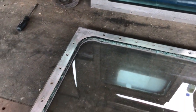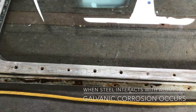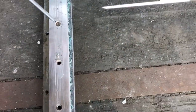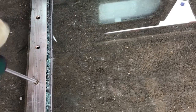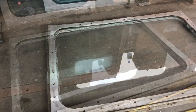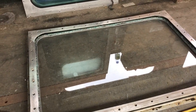Just to expedite the video, I've already taken bits of it apart. When you take a Pullman standard window out like you've seen in a previous video, if you want to replace the glass you have to take all these screws out all the way around. If they used stainless you're lucky; if they used steel and it's an aluminum frame, you're gonna have a bit of trouble. You may resort to drilling out the screws, but be careful that you don't wreck the underlying frame because the two frames go together in here. So I've taken the last four screws out — in the section windows there are 44 screws that you have to remove.